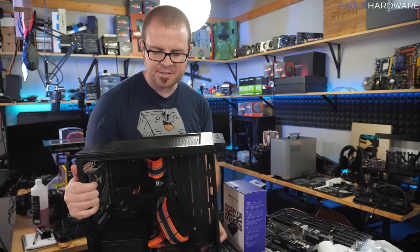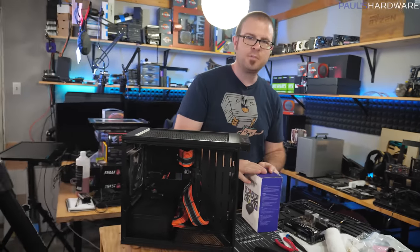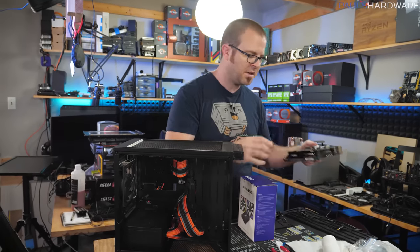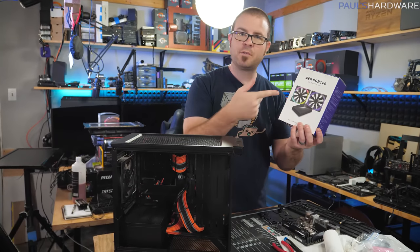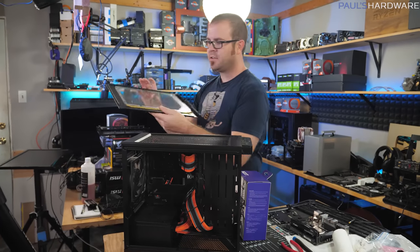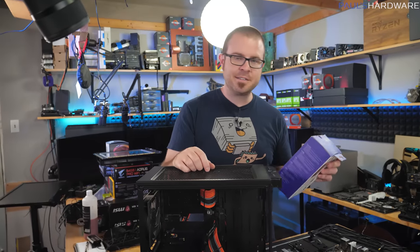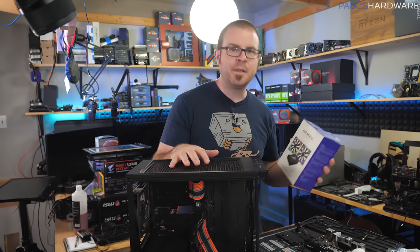I'm not going to be reusing this graphics card for now, so I might just leave it as a remembrance of the fluid that was once in there. The case itself has been cleaned out pretty well — I removed the power supply enough so I could clean in and under it, but I'm going to leave it in there because all the cables are routed pretty much where they're supposed to be. The plan now is to clear out all this water cooling stuff, reinstall an all-in-one liquid cooler at the top, and then reinstall the motherboard and everything back in there so I can get the system back up and running.